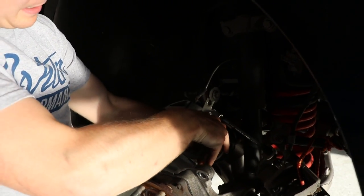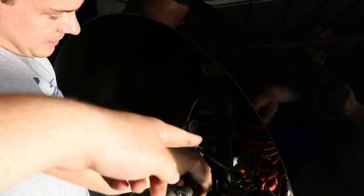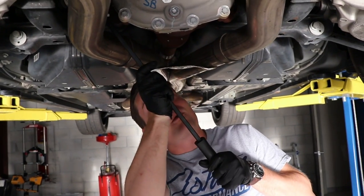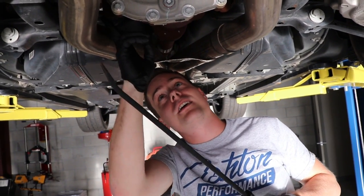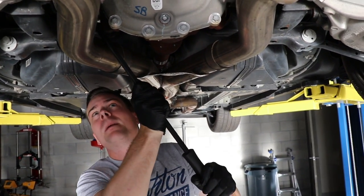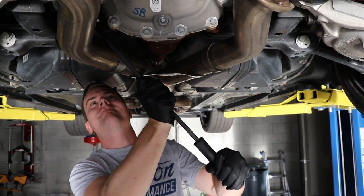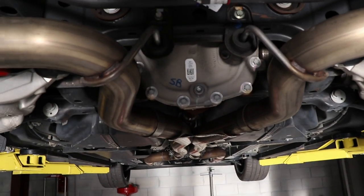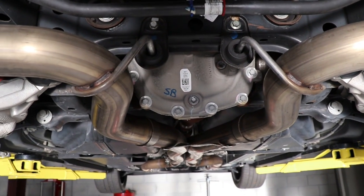So you can just let it slide there. When you pull it, we've got to pry it out of the diff. It's going to leak a little. So basically we took a crowbar - there's a little ledge here on the diff that you can just get in and essentially just pry it out. It's almost there. We can pull it out by hand. We've got a little drain bucket here in case it leaks - in some cases it does, sometimes it does not.